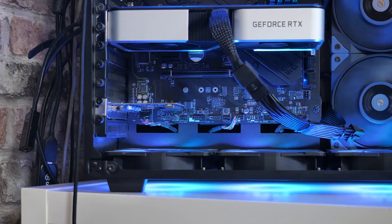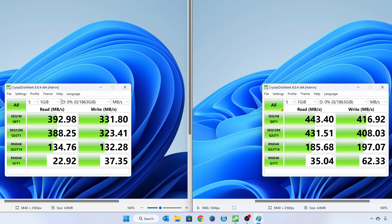It's all installed and I've done a brief benchmarking session. It's not going to be fantastic — there is more overhead because this is going through a chipset into the PCI Express bus. So it's not going to be quite as fast as your hardware motherboard USB ports, the super speed ones anyway. It's definitely faster than USB 2. Looking at the results side by side — on the left is the LUTeng and on the right is the MSI B550 Gaming Plus super speed ports — there is a little discrepancy. Neither is quite hitting the theoretical 625 megabytes per second, but we're still getting around 400 megabytes per second read and write, with the LUTeng tailing behind slightly.